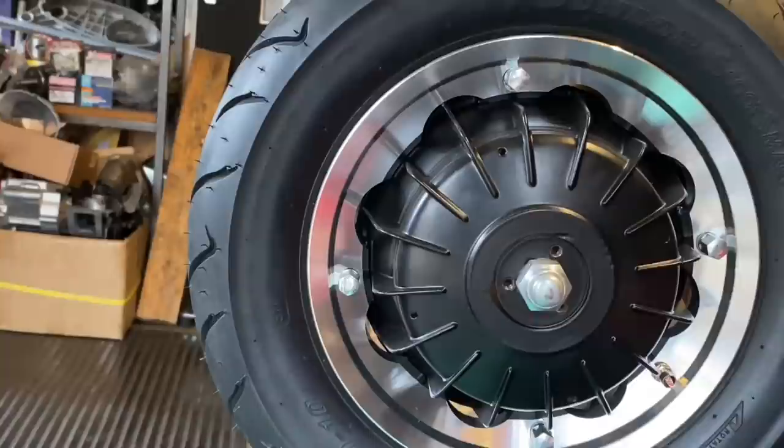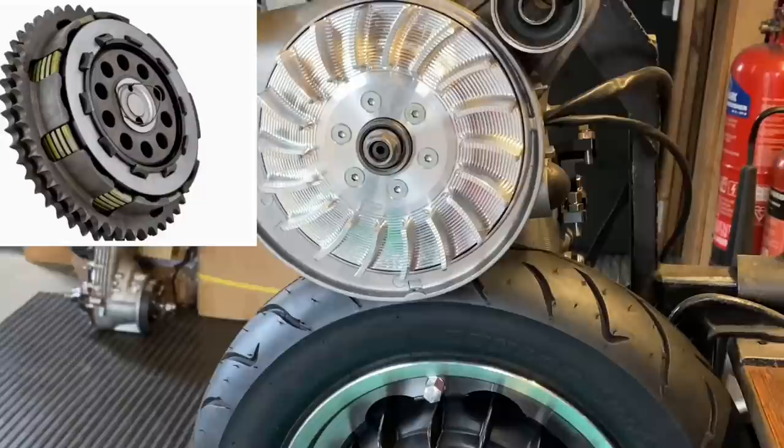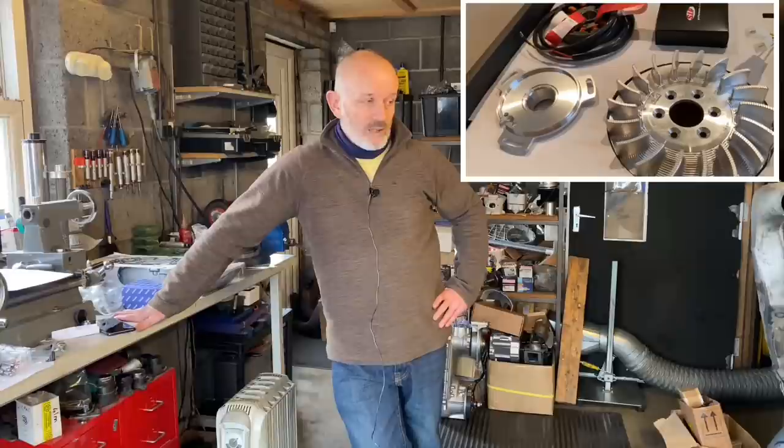We've got a close ratio 5-speed gearbox that couples up onto an LTH clutch, an iWis chain, and an LTH pull down tensioner, a high quality front drive sprocket, drive sleeve, cap, and components at that end. We've got a 65mm stroke crank driving through the centre of the case. We've got the Vape ignition, which sits on the end of the crank on the mag side. On the mag side, we've got either a uni mag housing that we carry out some modifications to,